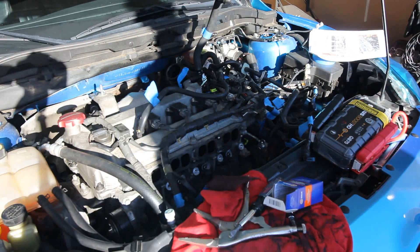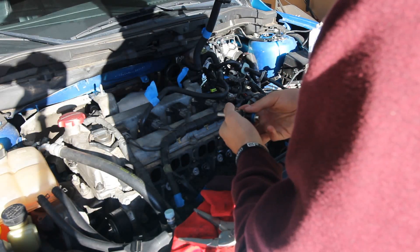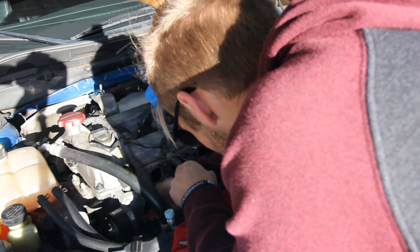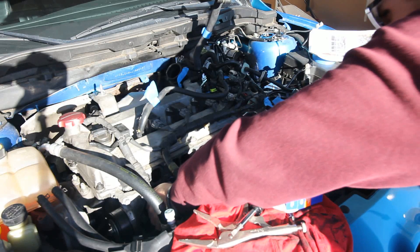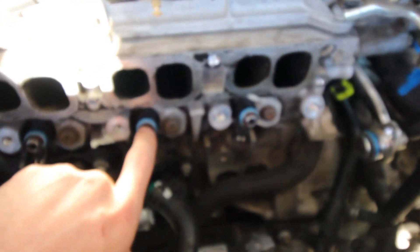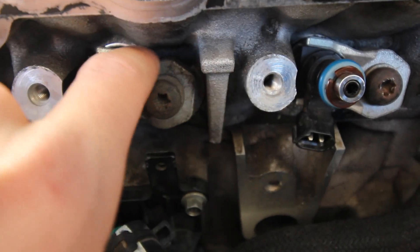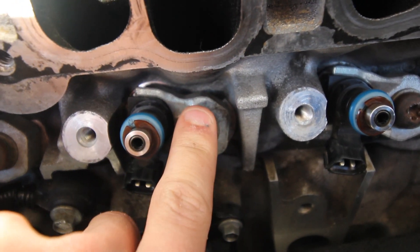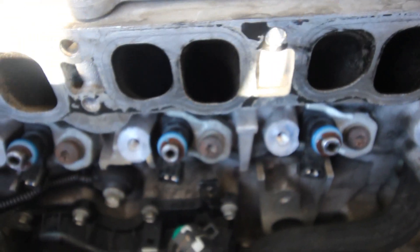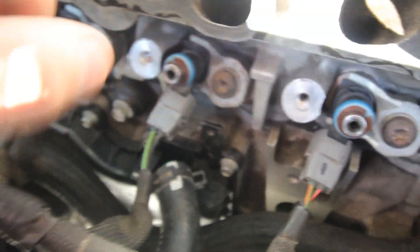So this is what I've done so far — I put the injectors back on. Then you put the little clamps around the injectors back on with their Torx 40 bolts and torque them down to 17 to 18 foot pounds of torque. The next thing is to reattach all the fuel injector clamps — there are four of them for four injectors.